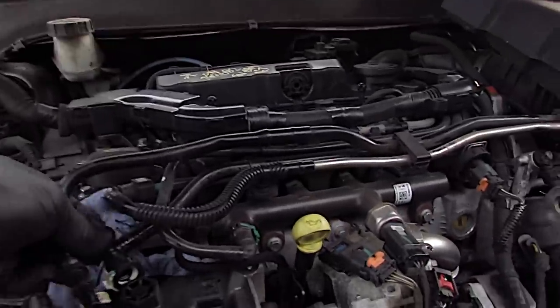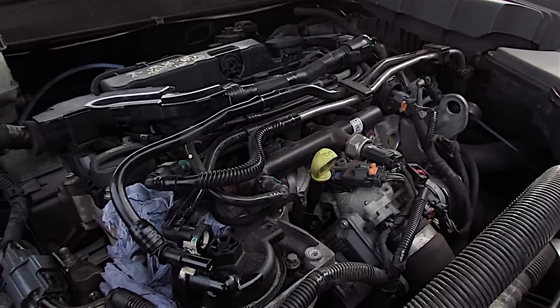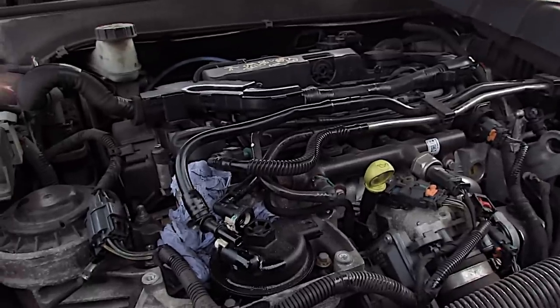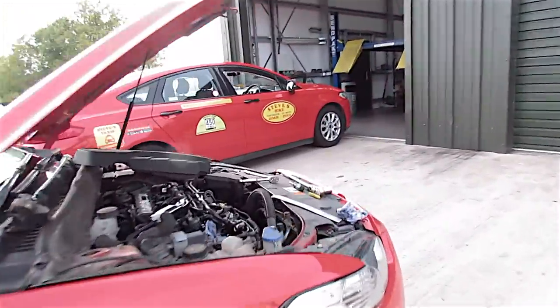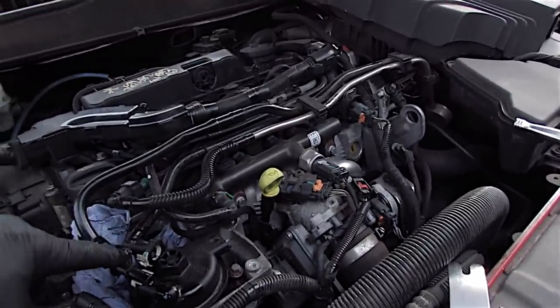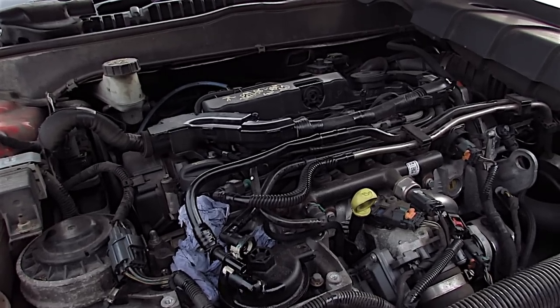So yeah, luckily there's only a little bit, he's only put like a fiver or a tenner's worth in there. So rather than trying to drain it all out, I can just fill the car up with diesel and it'll water it down and it won't be so bad. But as I noticed on this, I won't switch the ignition on because otherwise fuel's going to spill out of them pipes. But when I put the ignition on, the spanner light came up and it's showing low fuel pressure. It's obviously because there's petrol in the fuel pipes rather than diesel. It's not reading the right pressure. So I'll change this filter, then get this down the petrol station, fill it up with diesel, and that'll water the petrol down and that'll be job done.